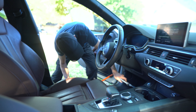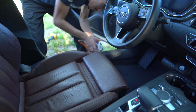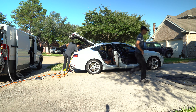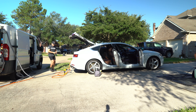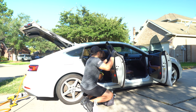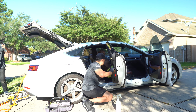Now it sounds like I'm really hyping up the cleaning gun, but it still comes with its own problems, especially if you are mobile. For instance, we have that dual tank rigid compressor, which is fine for a mobile setting, but if you use two hoses on it, it's going to keep turning on. The same thing applies if you have a craftsman pancake compressor — it's going to continually turn on and you won't have as much steady power. So maybe in that situation, using a steamer would be better. It really just depends — I'm not saying one is really better than the other. It comes down to your situation and the tools and products you have available.